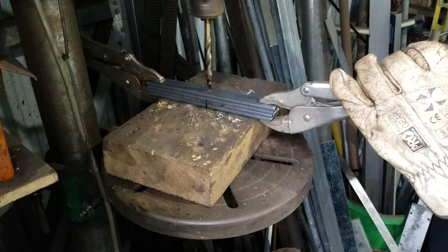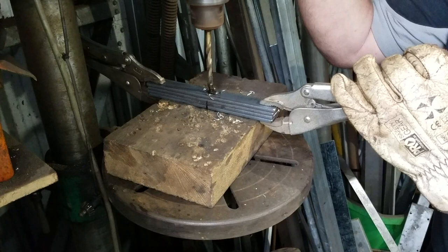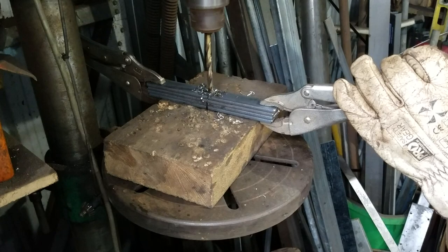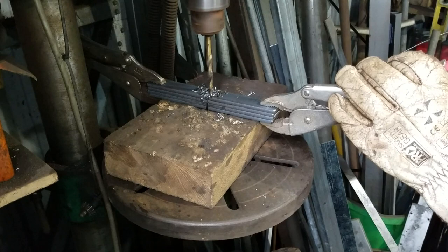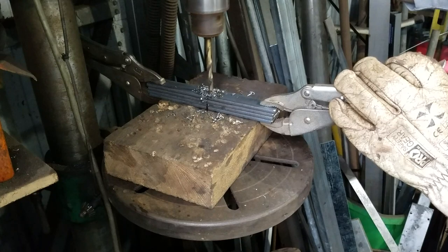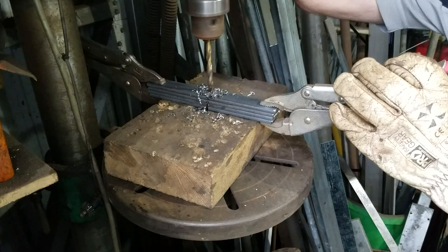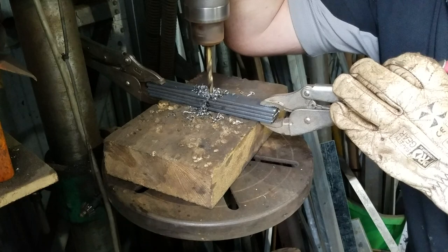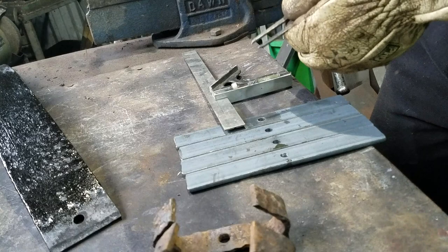This hole has to be as close as possible to the diameter of the rivets that are going to hold them on. The problem with the rivets is that Arches Auto Springs couldn't furnish me with the taper seat rivets I needed — they only had rounded head rivets, which can't be used on this spring pack because the next leaf goes over the rivet head, so it has to be countersunk. Not being able to buy these rivets, I went from hardware store to hardware store to find bolts with a tapered head that could do the job.